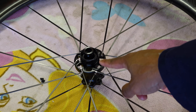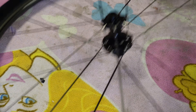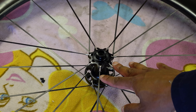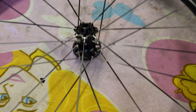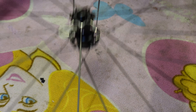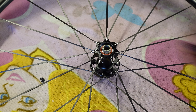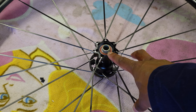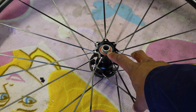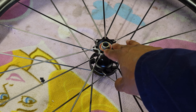This is the front wheel. On the non-drive side you've got the disc brake mount, which is a centerlock — it looks like a Shimano cassette freehub lockring. On the drive side you've got the radially spoked T-head spokes going in, all completely clear of any nipples. To service this you can just pull the plug out. Behind there you've got two 15267 bearings, which are quite oversized for the application. A lot of wheels have 6802 bearings there, which have a much lower load rating.